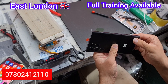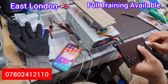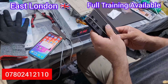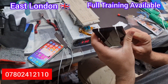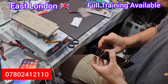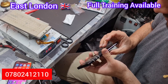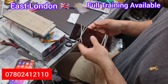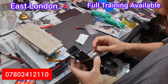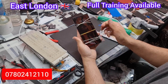Check that the edges are aligned. If there are gaps, put rubber bands around the phone so the back glass sticks properly. Leave the rubber bands on for at least one hour — longer is better. If the customer is picking up later, take the bands off after an hour. If they're in a rush, tell them to remove the bands after one hour themselves. Don't forget to like and subscribe so we can put more effort into our videos. Take care, bye.